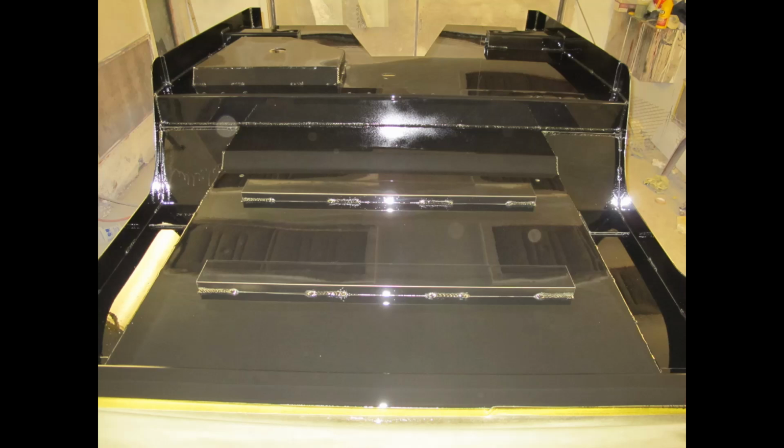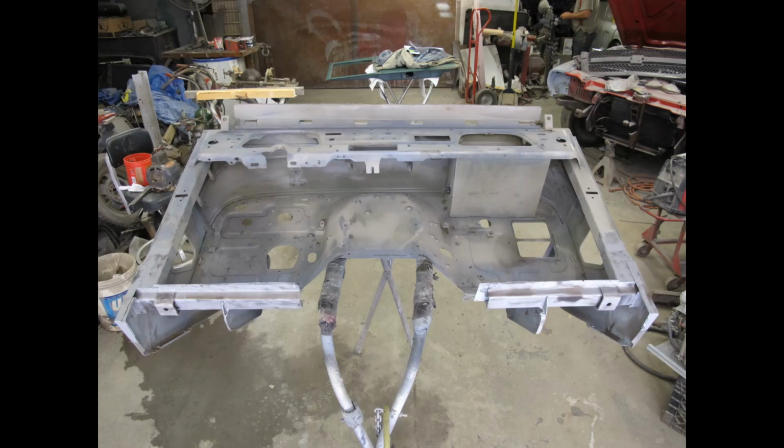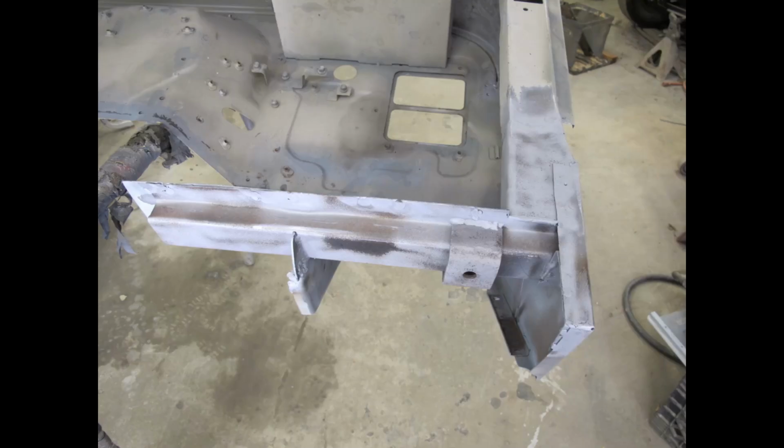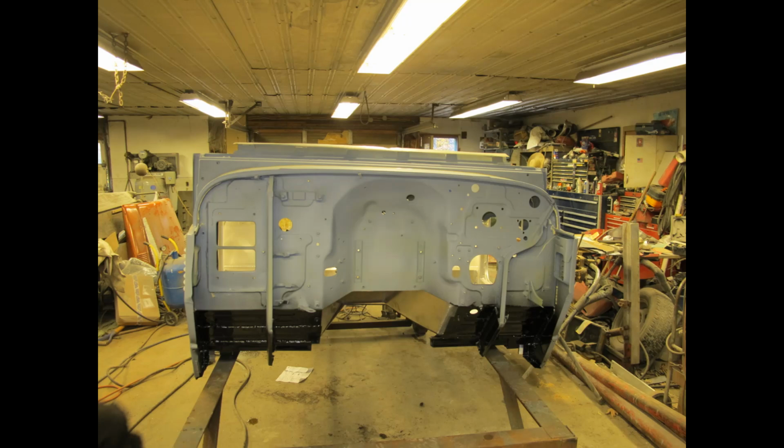After letting the Zinc Chromate primer dry, we sprayed 2 coats of Napa Rust-Proof MD black top coat, part number QTRP100, on the tub bottom. While letting this paint dry on the bottom of the tub, we turned our attention to the cowling. We sandblasted its entirety, filled all seams with seam sealer, and applied a gray Transtar Urethane automotive body primer. We also painted the bottom and the floorboards with the Napa Rust-Proof MD black top coat.